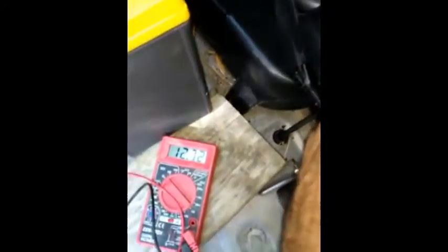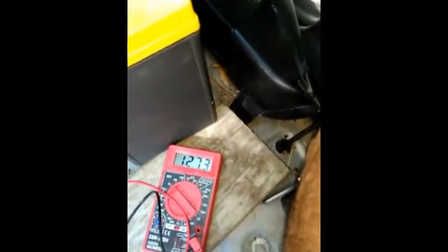I've been running this battery attached to that battery for several weeks. What's been happening is they've been cycling current back and forth between each other. This one was probably around 5-something volts when I connected — essentially useless. That flooded battery was hot at 13.1 when I connected it. So let me show you — that goes there, that goes there — what do you see? 12.7 volts. I just had this inkling it would be the case. It's actually 12.8 if the negative were tied in a little tighter, but 12.7 is plenty good. And I just started the car.